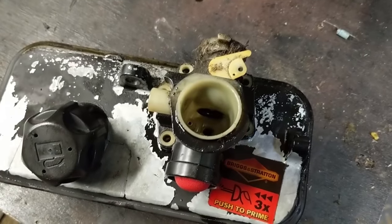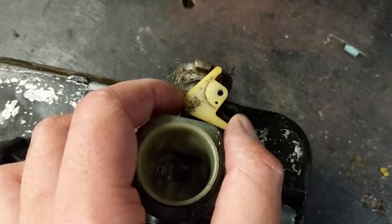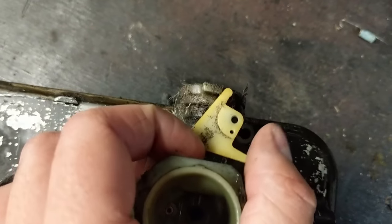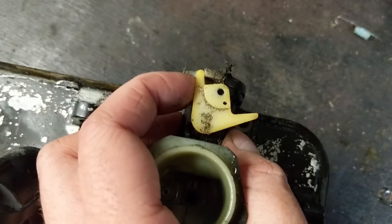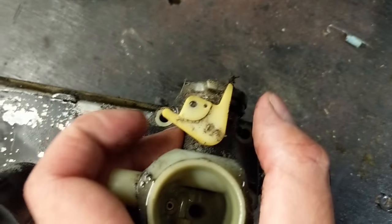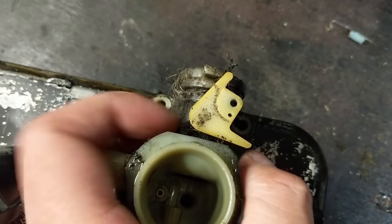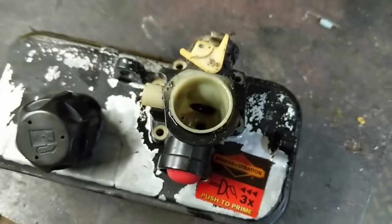With the five screws removed from the carburetor, when you remove the carburetor you're going to notice that the throttle is now on the right side of the carburetor when looking at the fuel tank from this side — that's not how it's supposed to be. There's a little tab there and you can simply pop the throttle over top of that. Sometimes when you're removing it because the spring's hooked up it's going to pull that over to one side. This is the side you want to have your throttle on — the left side — because if you go to reinstall it the other way your machine's not going to rev out and won't run right.